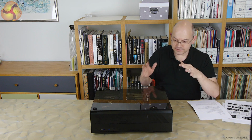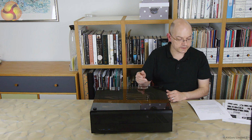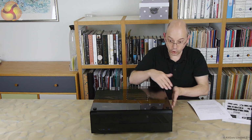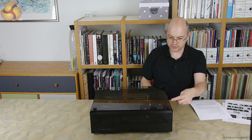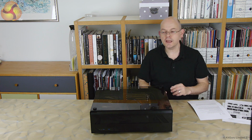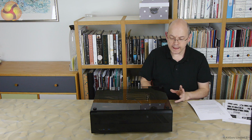And that actually takes us to the heart of the PCO5S. It's worth pointing out, by the way, this is the mini ITX version of the PCO5S. There's also a PCO6S, which is micro ATX, and a PCO7S, which is ATX. Now, when we get into this, you'll see that this top section, and we're going to have to discuss orientation, because if that's the front, this is the back. So is that the top? It's only the top of it stood upright at the moment. This is the side. But anyway, this compartment here holds two case fans. They're 120mm fans. And Lian Li says you can substitute that for a 240mm radiator if you like. Frankly, you can't, but we'll come to that in time as well.